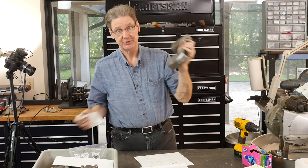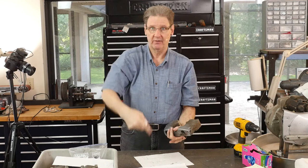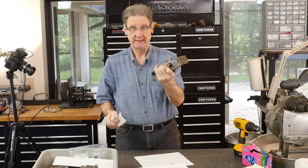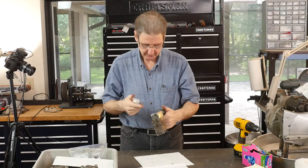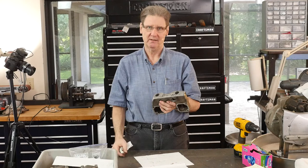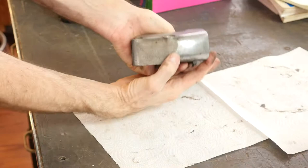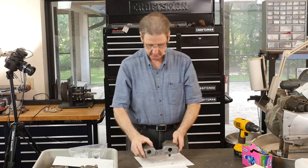It's all dull gray. Don't chrome aluminum in general, but never chrome these old rocker boxes. First off, it's old casting — it's not billet like the wheels they get away with chroming. This is a casting, and as my buddy says, castings are mush. Even if it's not porous enough to let oil weep through — especially once it's used like this one — there's oil everywhere in this thing. The plater will not be able to get it out and the chrome is going to peel.